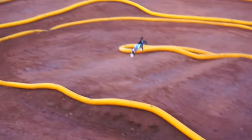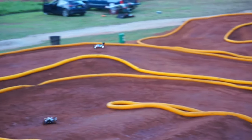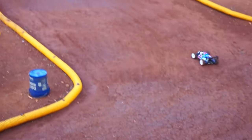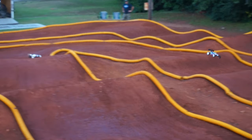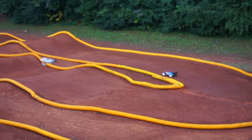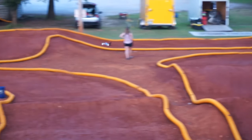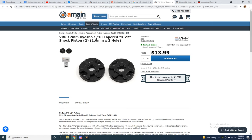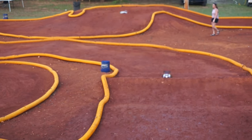At a loose dirt track called RC3 Raceway, I was able to use a lay down transmission with a couple of extra weights behind the motor and win the stock class that day — the guy in second was also using a lay down transmission. I did well with my short course truck as well, which also had a lay down transmission. One thing that would have been great for this specific track would have been the VRP XV2 pistons. There are many different types of pistons with different hole sizes and quantities — these VRP pistons are meant to improve the valving action over very rough terrain.